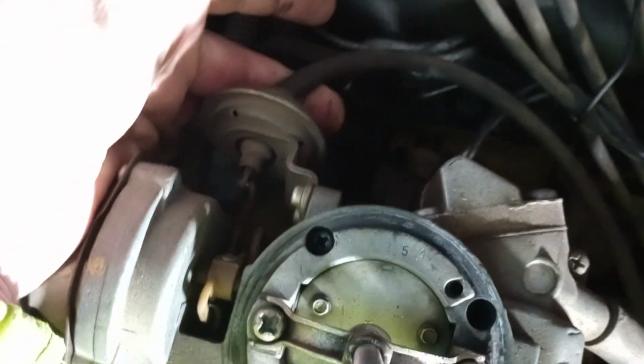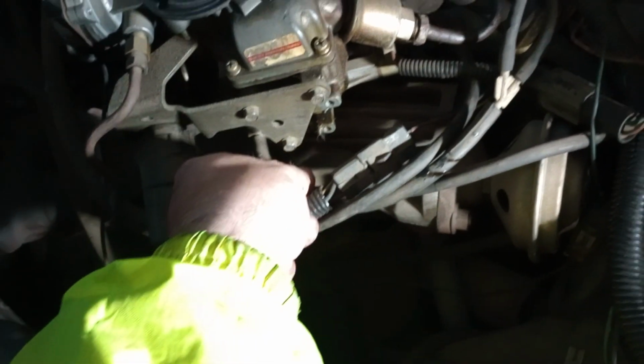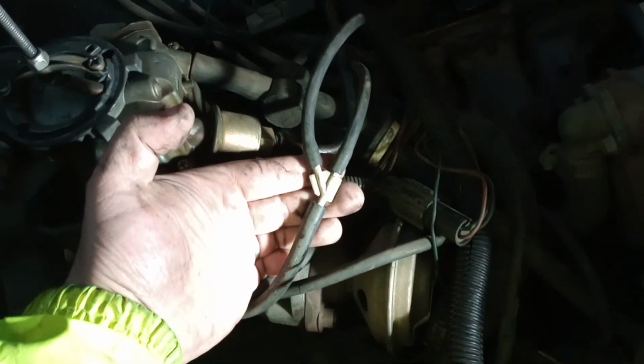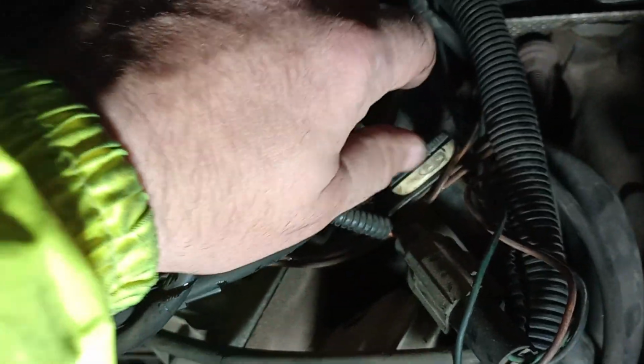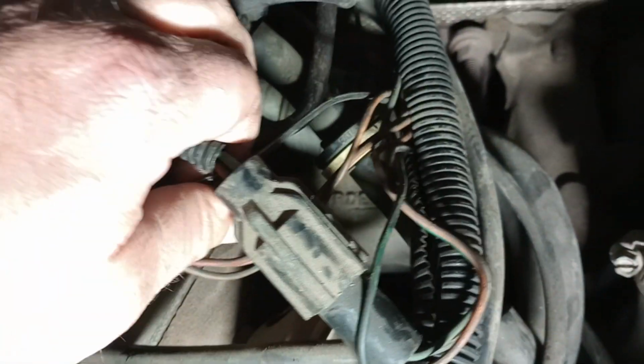So, vacuum lines coming off of this thing. We've got one here that loops around to the other side to this right here. We've got another one that comes up to this Y split. One side goes up into this. This is part of the evaporative emissions. This runs down to this one-way valve right here. This runs all the way down here.